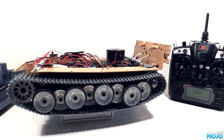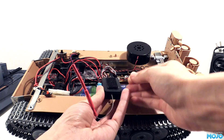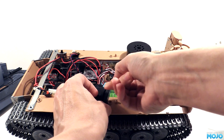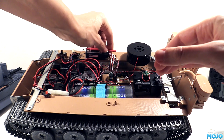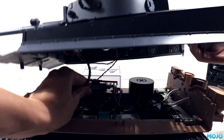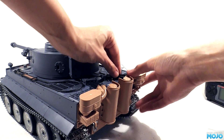We just need to do the final tidy up. I'm going to use some sticky velcro to mount the receiver up on the side, which will make it easy to take out for tinkering. The antenna can stick up on top for now with some servo tape — it's not ideal being right next to the speaker, but it'll do. The upper hull can go back on with its two connectors. Slot the tongue in, press the back down, slide the hoses on and we're ready to run.